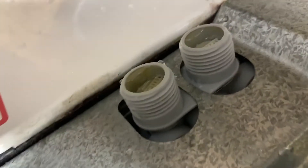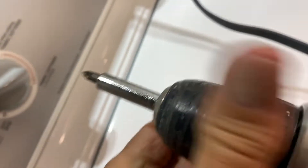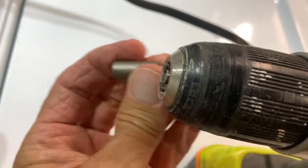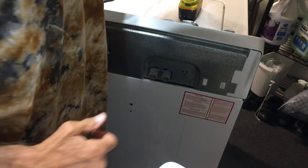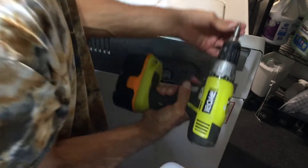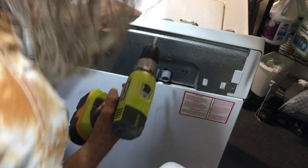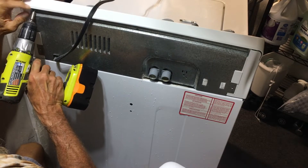There we go — this is the valve we're going to change. As you can see, it's exactly the same as the new one. Now we've got to undo these bolts. We've got to change this bit right here — loosen this, pop that out, stick the new one in, tighten it down. Now this is ready. We've got to take that faceplate off, so we're going in reverse. We don't want to lose these screws so I'm putting them right here — one there, one there.